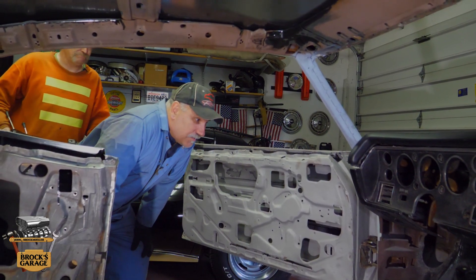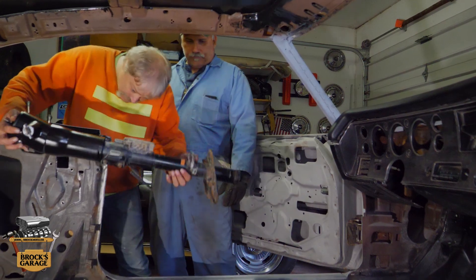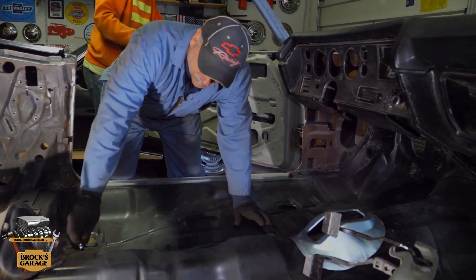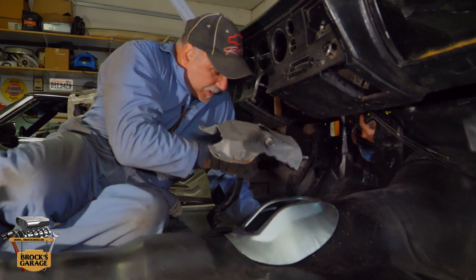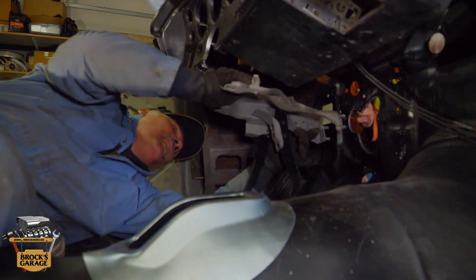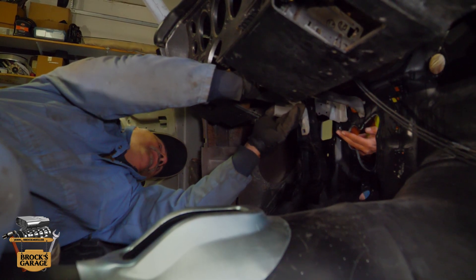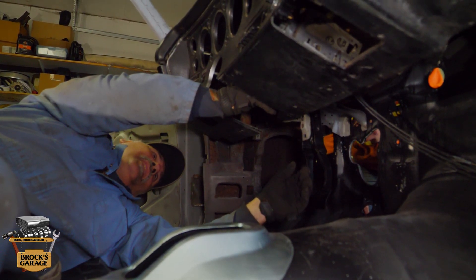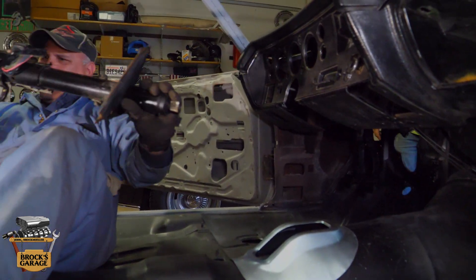I guess I drew the short straw, so I'm going to be the one on the back in here. We've got to get that bracket in first. So you want to set that down some more? Let me set this down out of the way carefully. I'll get on the outside here and guide it in for you. So I've got to put the brake and clutch pedal in first, which is always a blast. Give it a little turn clockwise. I'll throw a temporary bolt on here since we don't have a brake booster to support it. Put a bolt on the outside and you can hold this all there by yourself — some of you guys might be doing it by yourself, as I often do, and little ideas help.